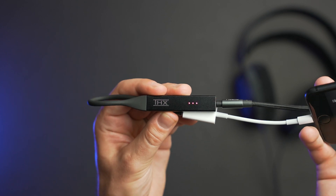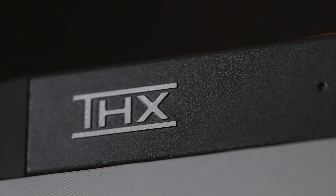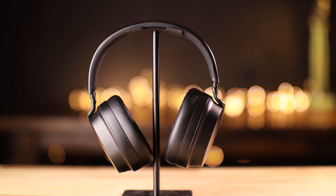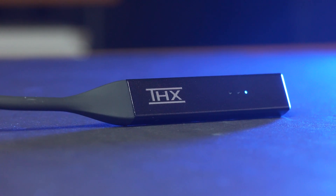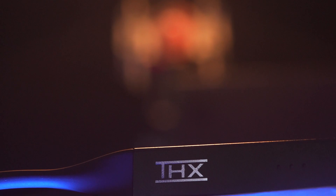At the heart of the Onyx is a THX AAA amplifier with five times the power of similar USB DAC amps. It can put out a ton of power but keeps things clean with ultra low distortion and noise. These THX AAA amplifiers have been used in many other products as well, namely the Drop Panda from last year, and they've already made a pretty good name for themselves when it comes to mobile audio. This is the first time that the THX AAA 78 has been used in a mobile device like this, and it delivers ultra low noise with incredible power. Onyx also features an ESS ES9281 Pro DAC for rendering studio sound quality.